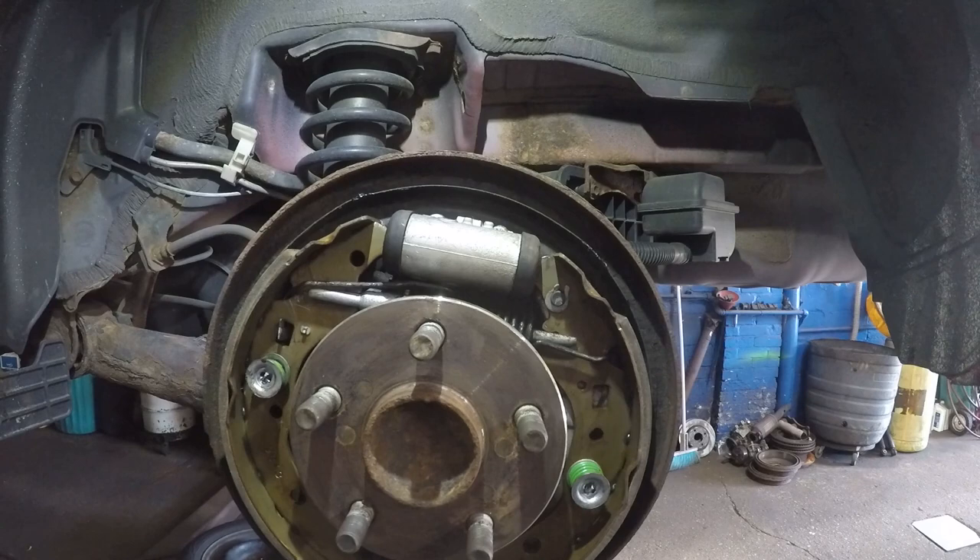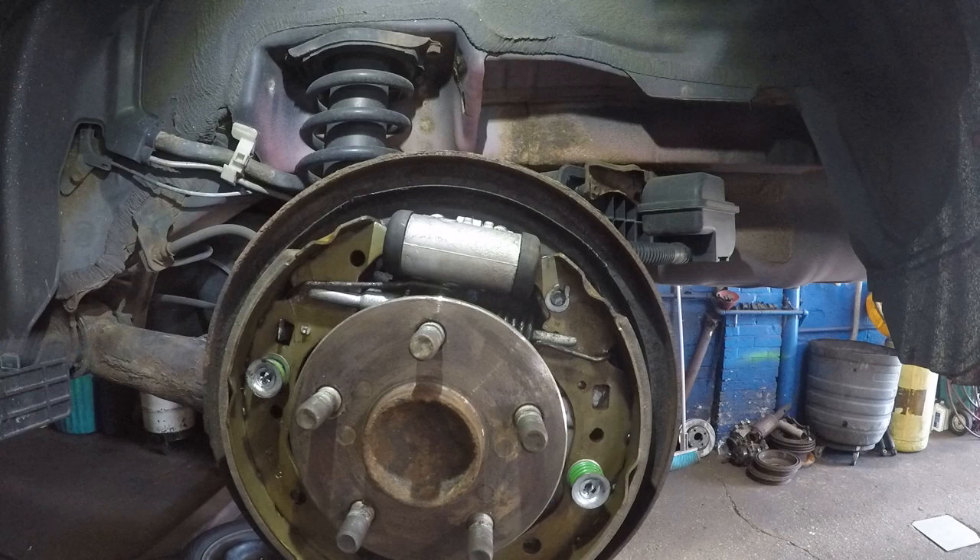If you have a lot of rust over here, you might want to clean it off. I forgot that point — just clean it all around, because as the drum turns it'll make noises. What I want to do is get grease on the rest — it's like one, two, three spots on each side. Do not get any on the shoe or the drum.